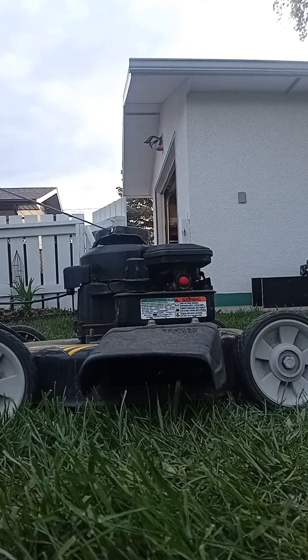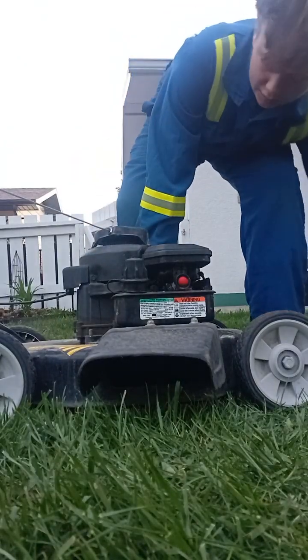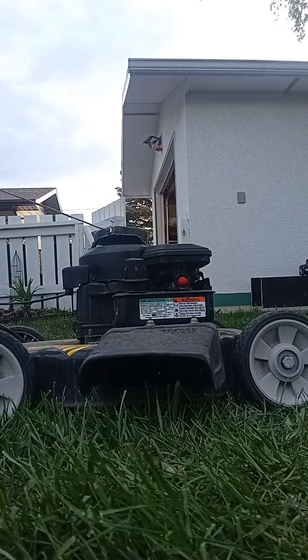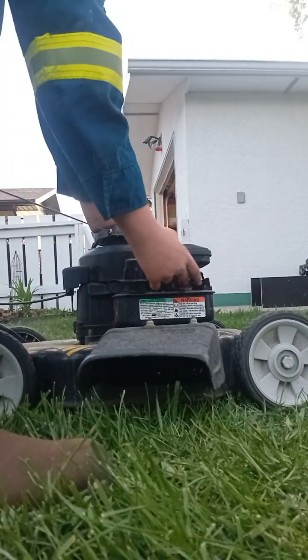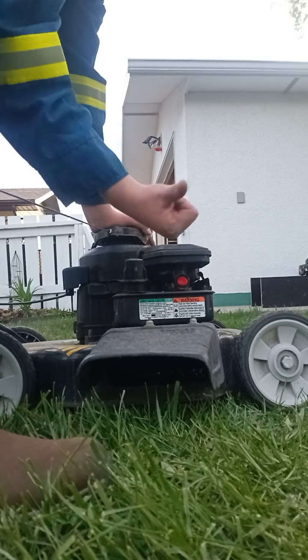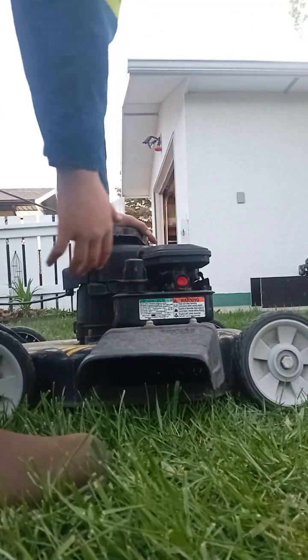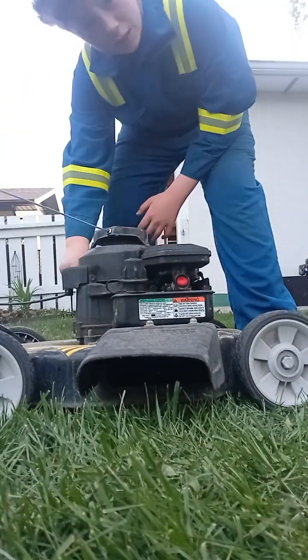So, as you can see, my mower has not been run. You can touch the exhaust and everything. The engine's not bad, and we're actually going to see if this thing runs. This primer wasn't priming any fuel last time, so let's see if we can hear it. Hear that? This primer valve is kind of slow to get back. You can hear that. So it's actually pumping fuel now. That's one good sign already. So let's pop that. It's about 3 primes you're going to need, maybe a little more since it's an old engine.